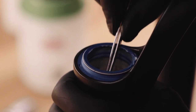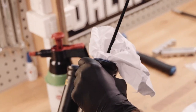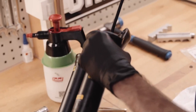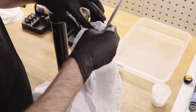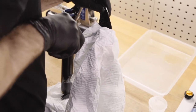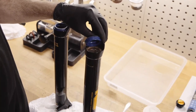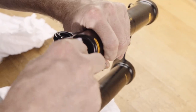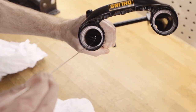Use a set of tweezers to remove the foam rings. Clean the lower legs. Remove the scraper seals by carefully levering them out. Avoid using tools with sharp edges when doing so, as these can easily damage the paint. Thoroughly clean the scraper seal seats. Take out the bump rubbers from each lower leg. Make sure not to scratch the inner surfaces of the fork.